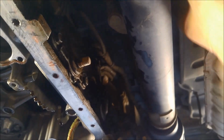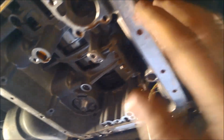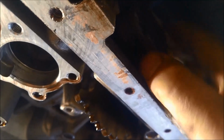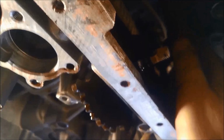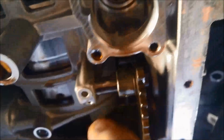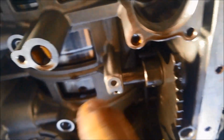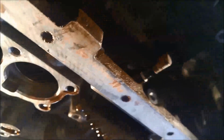14mm. I'm just going to swing it out of the way above that front tail shaft, and now we're going to take these two 10mm bolts off and just slide that off. And I'll swing that out of the way as well. So there it is. It looks like it comes out this way, and now I've got to knock that pin out. Just note how everything was sitting, and then just slide that out, and there'll be an O-ring on that shaft.